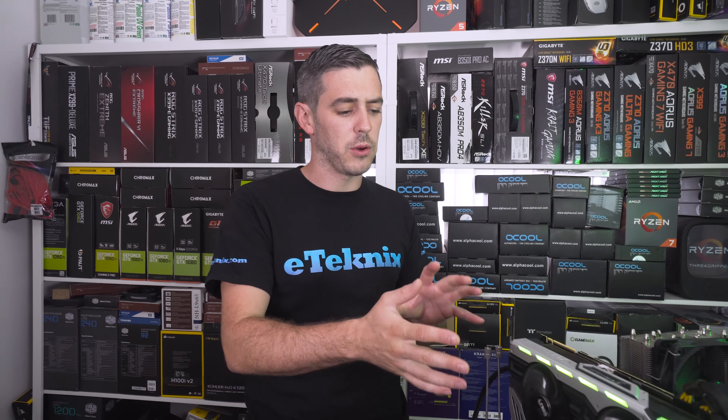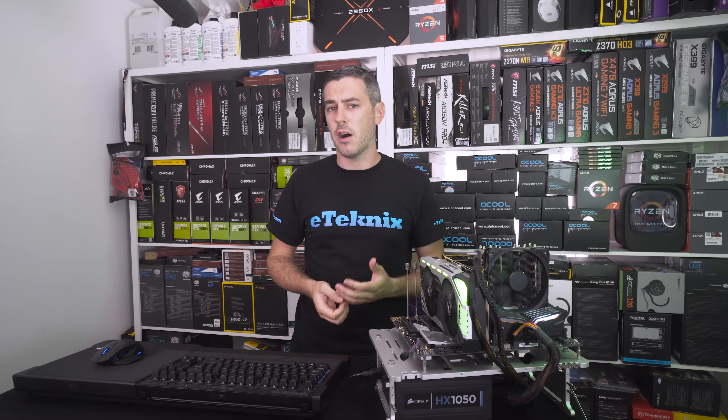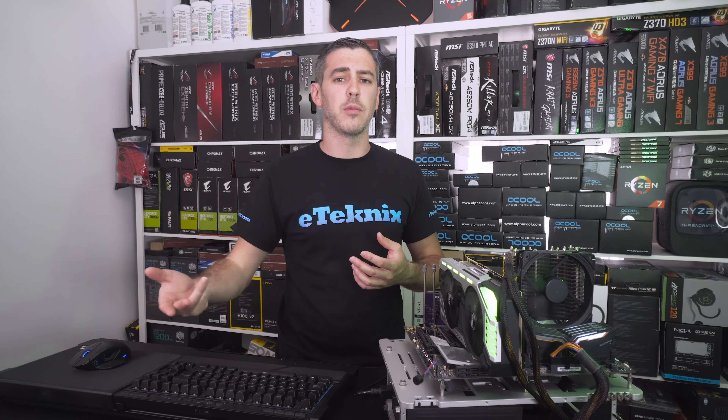In terms of acoustic performance, that's all down to Palit, and it seems roughly where we'd expect. There's a Vega card and a 1080 Ti above it, so they've done a great job with the Super Jet Stream cooler. Temperatures were kind of where we expected, maybe just a little bit higher than I'd hoped. Power consumption — I was actually expecting a lot lower. There's been some talk about idle power consumption and we actually think that may be something down to the drivers. Nvidia take feedback from reviewers and consumers and will be working on developing the driver further. I'd take today's results as preliminary — update your drivers in the coming weeks.